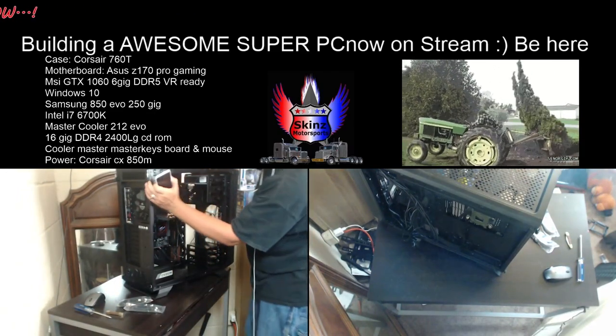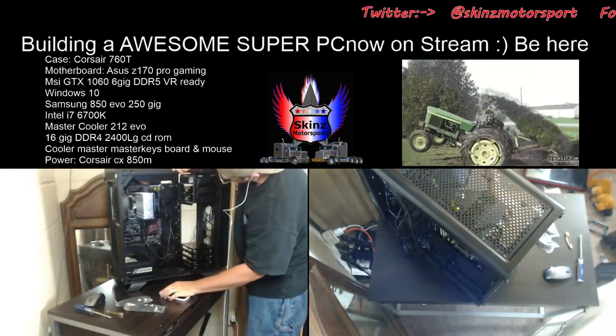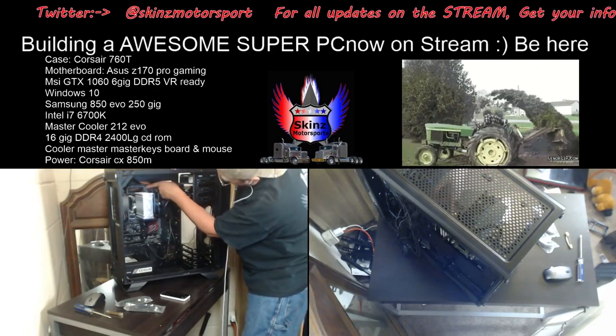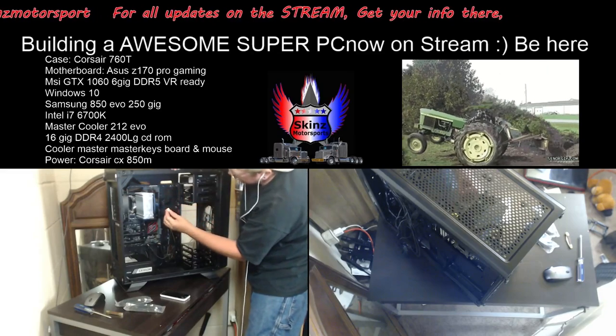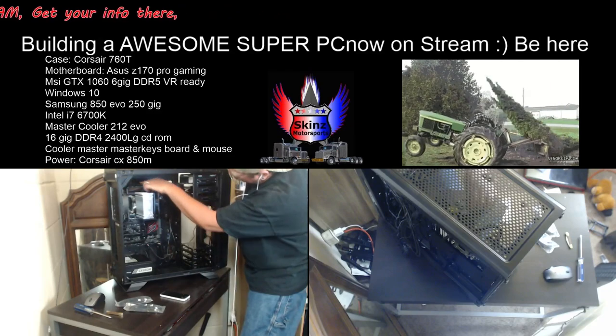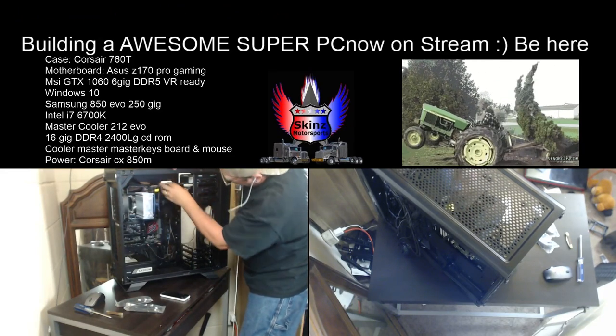CPU fan, right here at the top of the motherboard. There's a tab on the edge of the 4 pins, so we want to make sure that slides into these slots. We want to turn it the right way before we install the CPU fan.